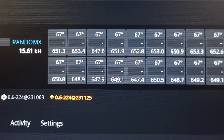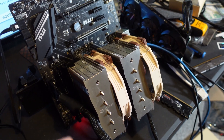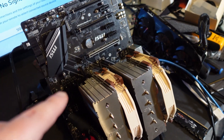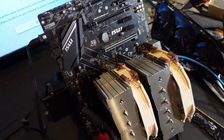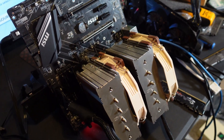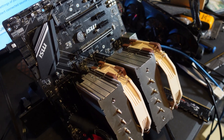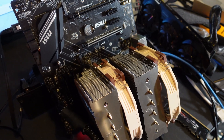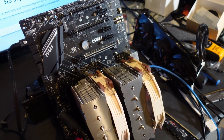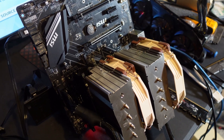I'm back down to two sticks of RAM and got the other two sticks back into rig two. I settled at about 3.7GHz and 0.98 volts. I'm going to have to watch this one for a few days to make sure it's stable, similar to what I did with my 5950X. Then I'll probably change rig two around as well, since they're also 3900Xs. Right now I'm back at 3.7GHz, 0.98V, two sticks of RAM, XMP profile on for the RandomX algorithm.